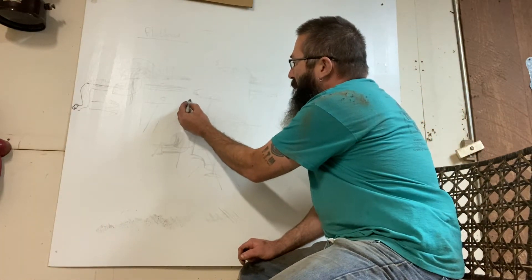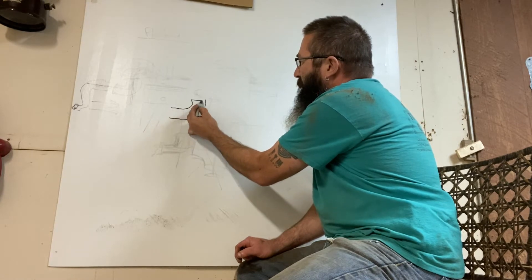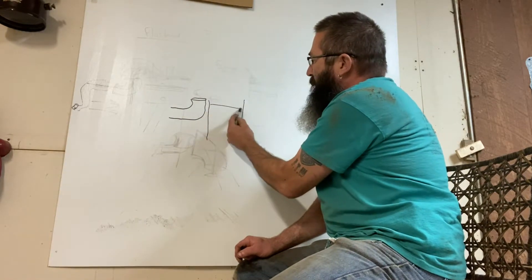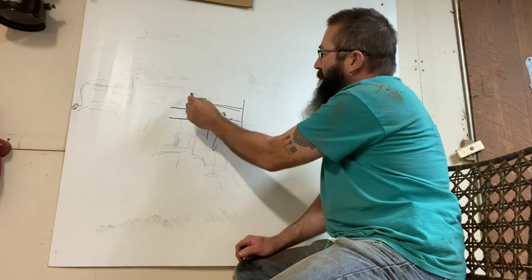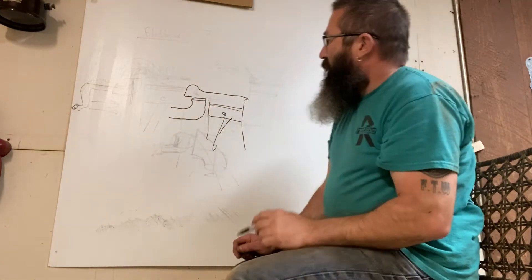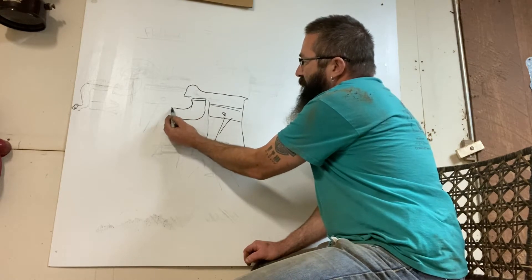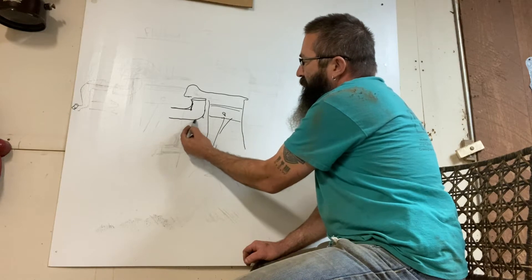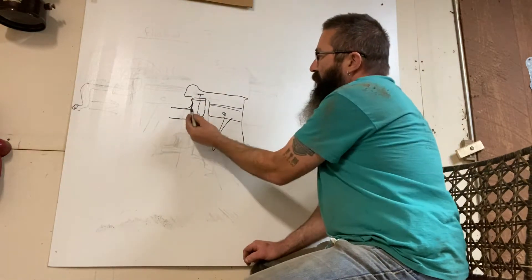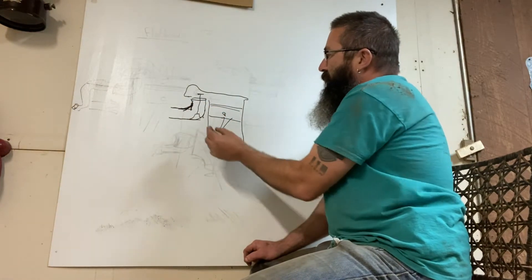Let's go ahead and draw an intake port. Let's put a cylinder in there. There's our piston, our cylinder, and our combustion chamber — this is our cylinder head. In the previous installment we took this sharp edge — there's what it looks like from OEM, it's just terrible. You've got a big boss right here where your valve guide is. We already took that out and made a nice smooth short turn.